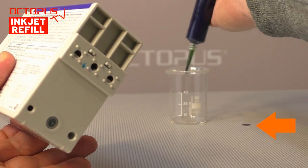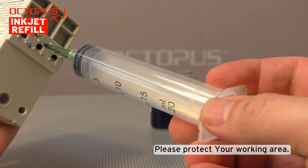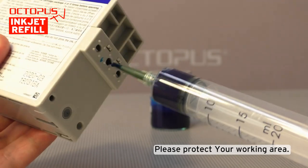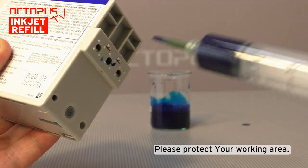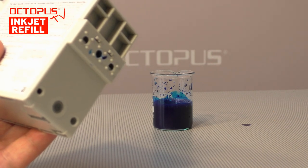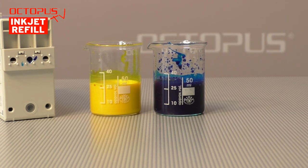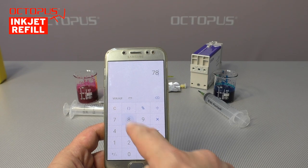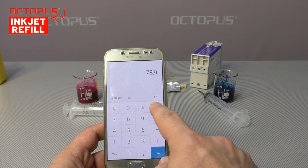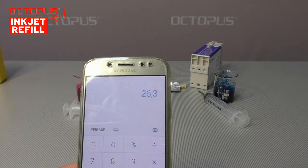How do you know that the bag is empty when doing the extraction with the bag inside the housing? It is empty when you cannot pull out further ink and also cannot pull the plunger of the syringe any further. Also for the cyan printer ink, we give the extracted ink into a container — it can be used again later on for refilling. From the yellow ink bag taken out of the cartridge and from the cyan ink bag inside the assembled cartridge, we could extract an amount of 25 to 26 milliliters of printer ink from each bag. That brings up the question: what is the right amount of refill ink for each bag? The original amount of ink stated by Epson is 78.9 milliliters per cartridge, which makes 26 milliliters of printer ink per bag.